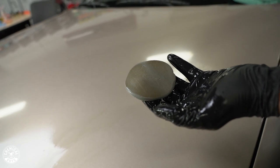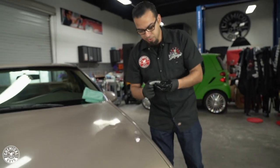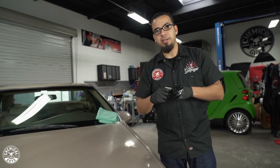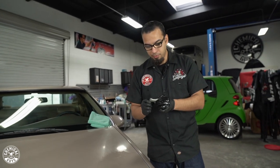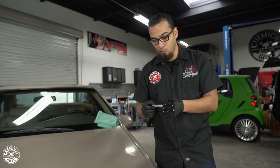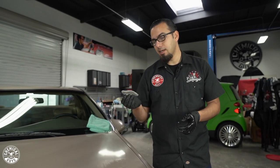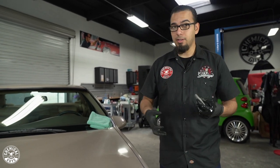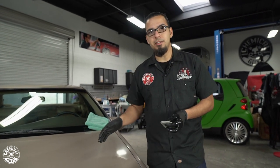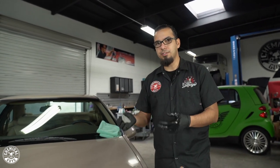This bar is probably going to need to be replaced pretty soon, rather than on your average vehicle. What you do is knead it up and roll it to a new side — that's how you get a fresh surface. As you collect dirt it gets stuck in there, so once you see the lines or have nowhere else to roll it, that's when you need to replace it. Also, if you drop it, it collects all the rocks and dirt from the floor, and putting that back on your paint will mar and scratch it. I recommend cutting the bar into pieces so you have a fresh piece in case you drop it.